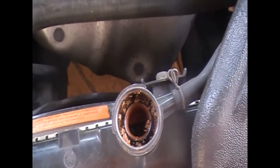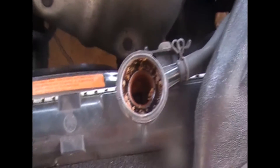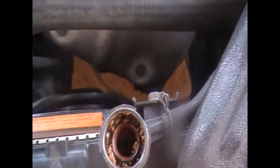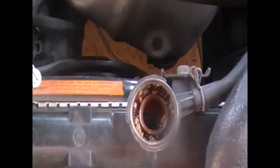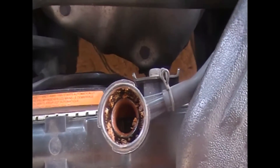I'll put some new coolant in there and hopefully there's no foam built up inside the block that's going to cause dramas. Also checking the oil — she's running low on oil as well, so it's important to check your water and oil all the time. If you're adding coolant, add the same coolant you used before. If you don't know what coolant was used before, flush your system and put in coolant that you know what's in there.